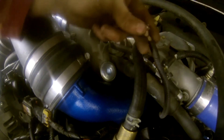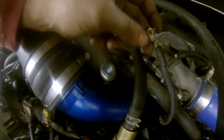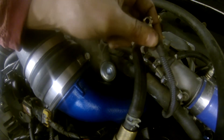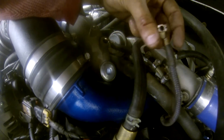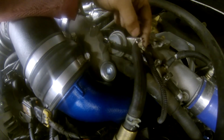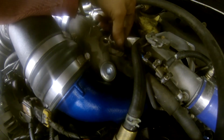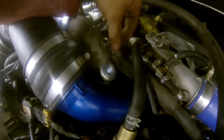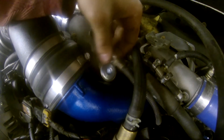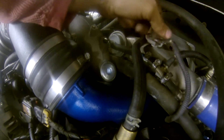What you will do after that is tape up your power wire — make sure you tape it up because if this ever does come on it will create a lot of arcing, and arcing is not good. Heat shrink it, do whatever you want to do. Then you can tuck it under here and zip tie it onto your turbo hose or down here — just put it somewhere that you're not going to have any issues and make sure it's covered really well.